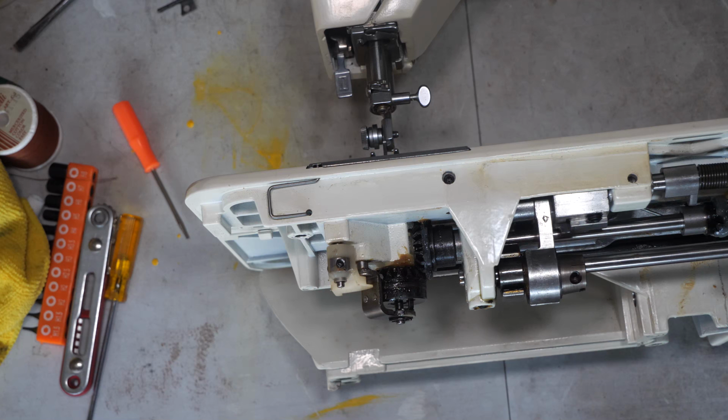All right. As you may have guessed, this is the Creative Touch Fashion Machine 1036 again. You'll remember I'm having challenges with the feed. I commented Randy the Sewing Machine Guy, which I know I've linked before, and he got back to me right away, and on the same front feed shaft as the feed gear, you'll see the eccentric by the bushing support for the feed gear shaft. So that's this eccentric.